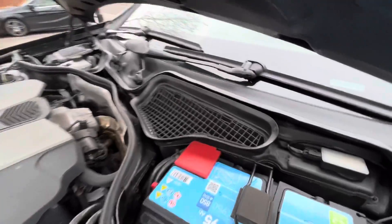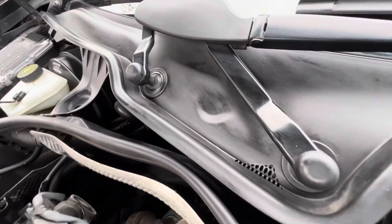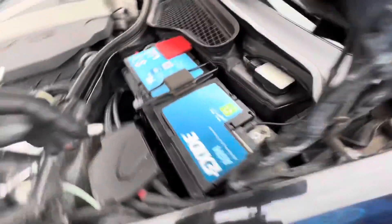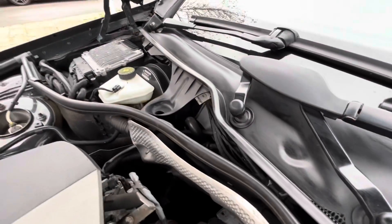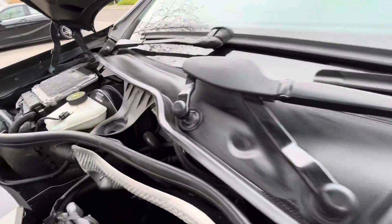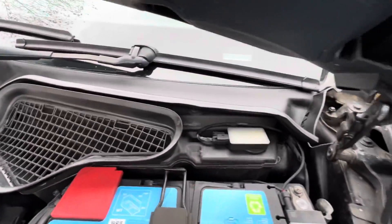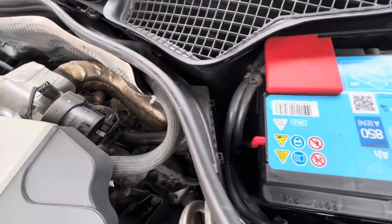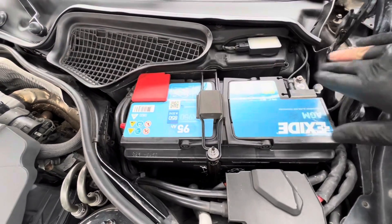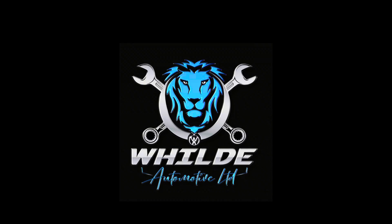I think you can finally agree that it's much better now — all the way along, all clean in all of these. Make sure it's all well cleaned — don't use anything too harsh because the plastic will just go really brittle. I used a little bit of bathroom cleaner with soapy water mixed — only a tiny bit of bathroom cleaner and a lot of soap and water — and then afterwards went back with some tyre shine to let that absorb into the plastic and the rubbers so they don't perish or crack. She's all clean, battery all in, all nice and clean down there, all bolted back in. There's a 13mm down here to hold it with the main clamp, then a small clamp on the top that hooks around this end — 10mm there — caps all on, both terminals tightened up.